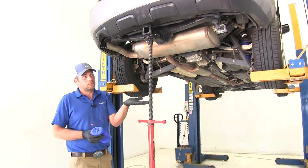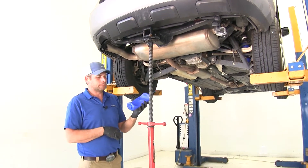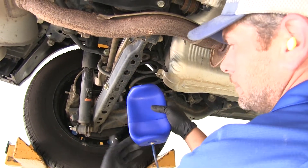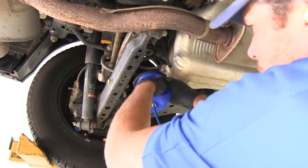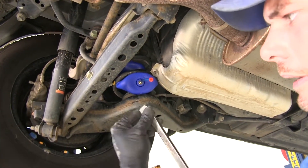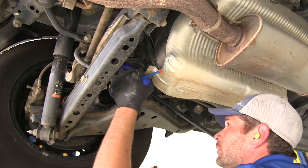It's a good idea to raise up the rear of your vehicle a little bit, as it allows our coil springs to expand and makes the airbag installation go a lot smoother. Here on the driver's side, you can see your coil spring — it's going to be right behind that fuel tank and just in front of the rear control arm; the upper control arm is here. We want the top of our bag up, so we'll position it like that, kind of wedge it between those two coils, and continue to feed that upward through the spring. You can use a blunt tool — we've got a pry bar here with a nice rounded edge — just to help guide that up into position. You certainly wouldn't want to use anything with a sharp edge, as you don't want to do any damage to the airbag.